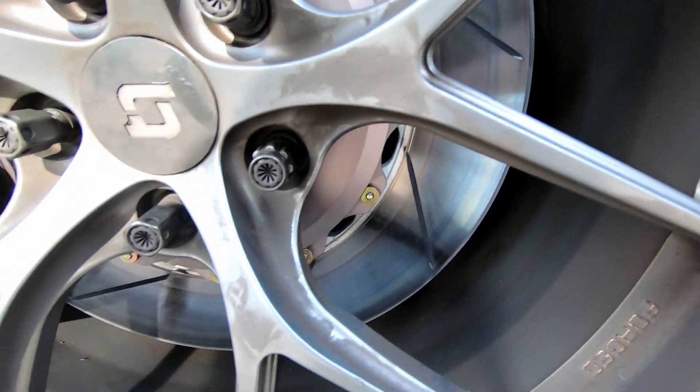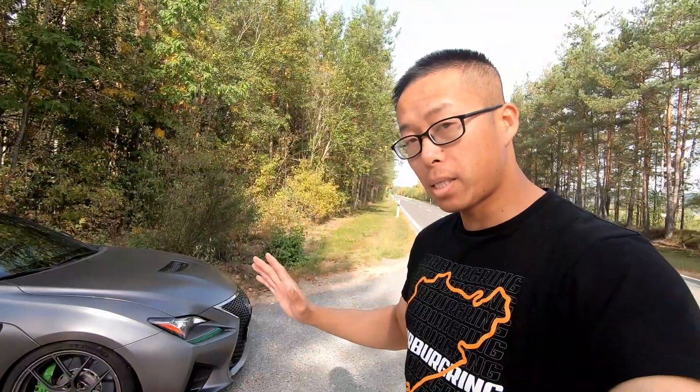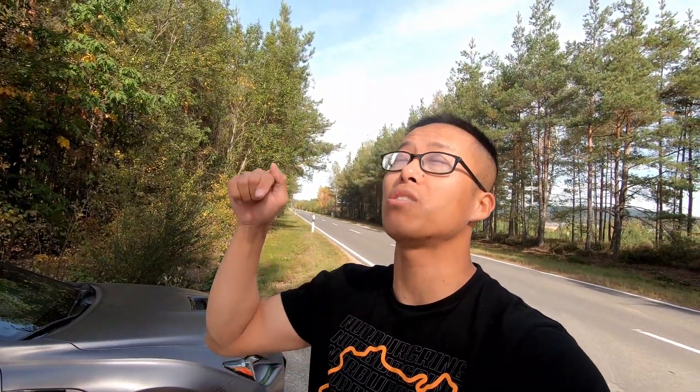This right here is a sign of brake pad material getting on it. All right guys, just like that — that is how you bed in brake rotors and brake pads. The procedure: you go to 45, brake to 15, do that about five times, then you go to 65 or 70 and brake to 15 about 5 to 10 times. You want to do each run within a minute of the last one, preferably in a continuous series, because you want to keep the heat and friction building up to generate the heat to bed in the brake so you can get that blue film. If you guys think you learned something, please leave a comment, and please like, comment, and subscribe. Thanks for watching, guys — peace.